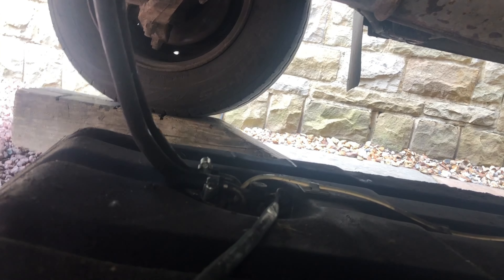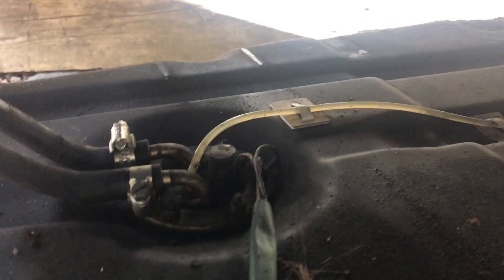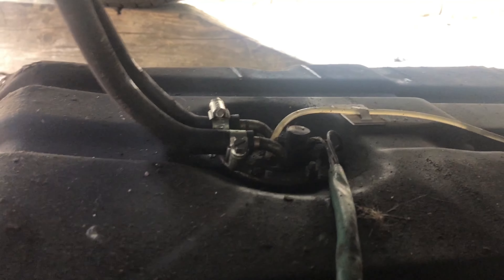There was actually quite a bit more diesel in there than I was expecting. We've lowered it down and all's well — you can see the Chinese diesel heater pipe there. One thing I should have done was liberate those two fuel pipes from that clip. I've quickly done that, so I'm going to mark these two hoses up prior to removal so I know which is which, and then we'll drag the tank out and inspect it in the full light of day.